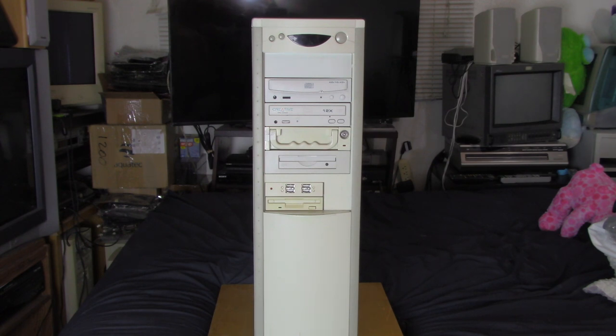Now, for Windows 2000 and Windows XP, where the dual CPUs do work, you get a little extra oomph in your OS and just scrolling around and doing basic OS stuff, and that is nice. But unfortunately, the Celerons just aren't powerful enough really for serious gaming in Windows 2000 or Windows XP. I mean, they're good enough for some stuff and early XP stuff, but it's like you saw with Quake 4, and that is considered an early SMP game. The CPUs just didn't have the instruction code.